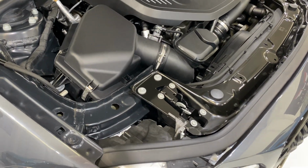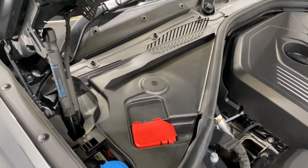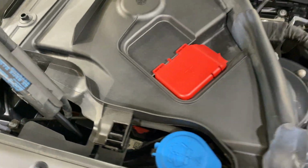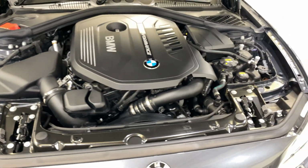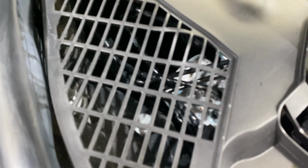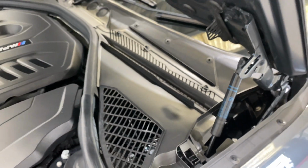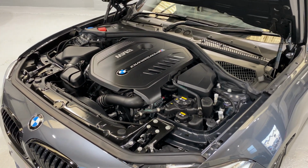Now the whole engine bay is cleaned by hand. We use a lot of WD-40, a nice safe product. Everything, all this is hoovered out. If there's any leaves in there or anything. As I've said in a few of the other videos, you don't really want to be jet washing into these little areas down here, because you've got things like your ABS unit and stuff in there. And not only that, you don't want to cause a sludge that blocks the holes and then stops the drainage.